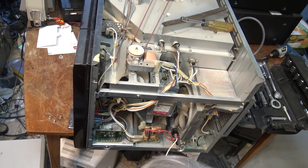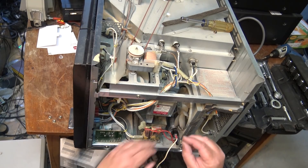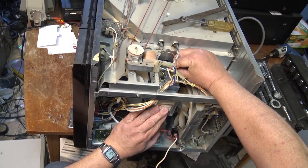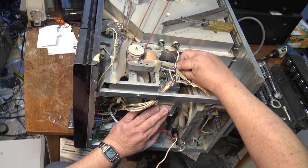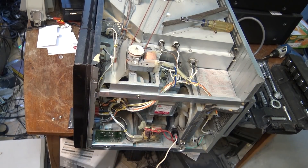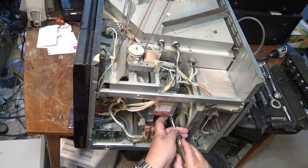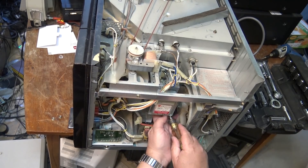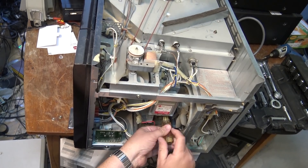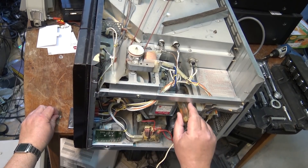Now, this one that's going in — I know nothing about its condition. When the microwave failed, the problem it had was the relay shorted and the power stayed on without the fan running until it overheated and kicked the thermal shutoff. So I don't know the condition of the magnetron that I'm putting in. We'll find out pretty quick whether it's any good. You've got four weeks waiting, right? Yep. Where does that come from? I don't know where they get them from.